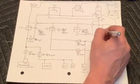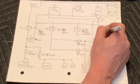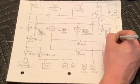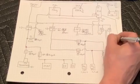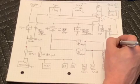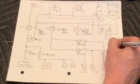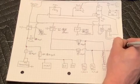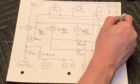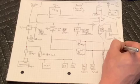And then I was just going to show you a little bit more on the 2 fan relays. So like I said, they are triggered on the negative side of the circuit directly from the ECU. The hot side of the circuit needs to come from the battery, and you want them to come on only when there's a key in the ignition and turned on. So you've got hot battery power feeding them, and then keyed switch power to help control them.